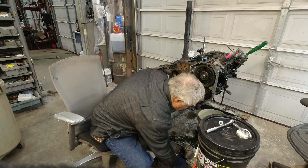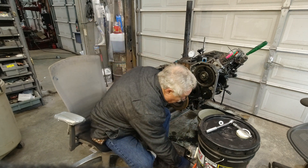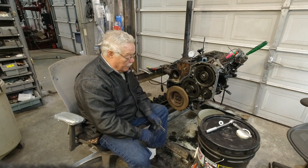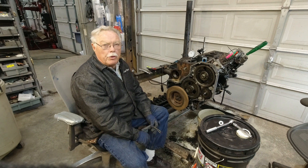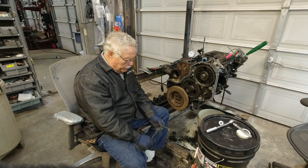This engine had multiple problems, as you see. It's the number six piston — it was melted. We got it out so we can rotate the motor fine. The motor, I think, is salvageable. The cylinder definitely has to be bored.